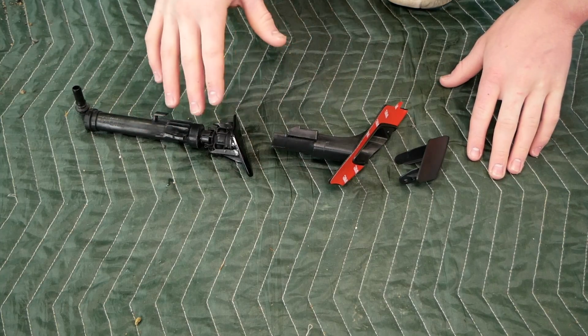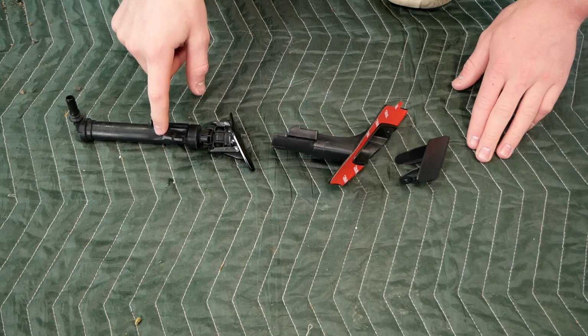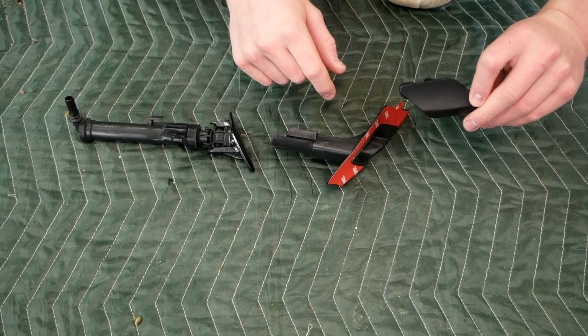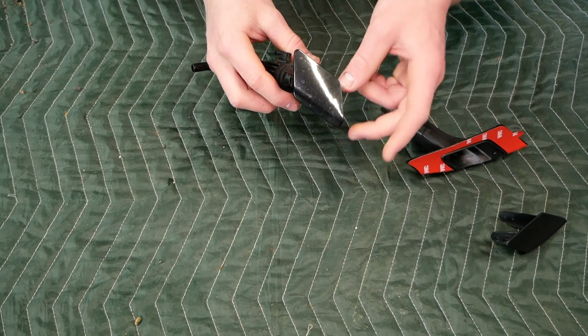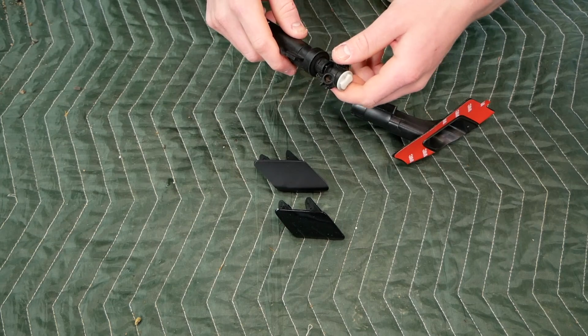So we're now going to prepare the headlight washer to be installed on the bumper, and take note that I have the passenger side washer mount, and the passenger side washer cover. First step here is going to be to remove the stock cover here. Take note of the orientation. We're now going to install the unit.